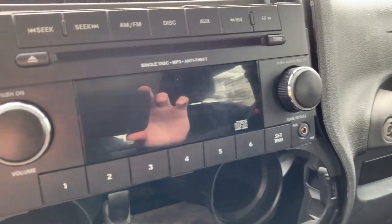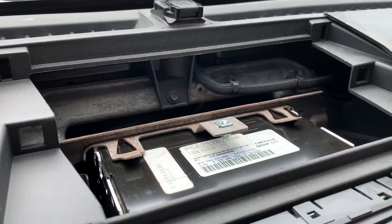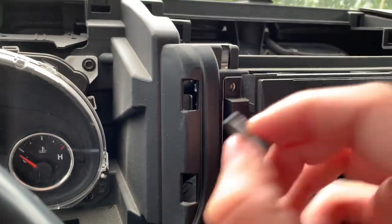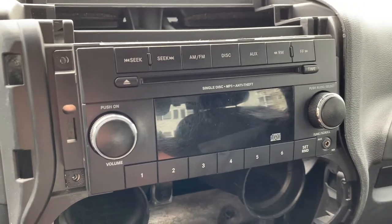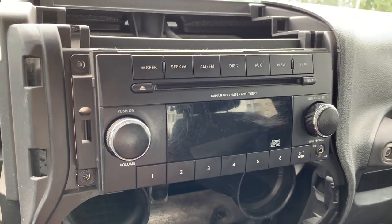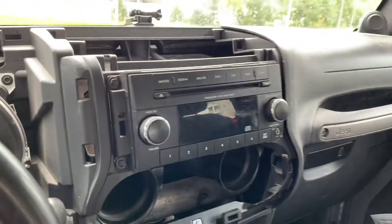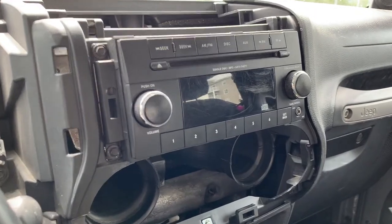The new radio's in. There are two metal brackets on the top and bottom that sandwich the radio in there keeping it nice and snug. It's just these four small black bolts that go through there. I'm going to test out this radio before I snug anything down — I've already tested it once, but it has that security code thing and I don't want to get locked out of it again. I'll test it out, then put all four bolts in and put the dash pad back on.